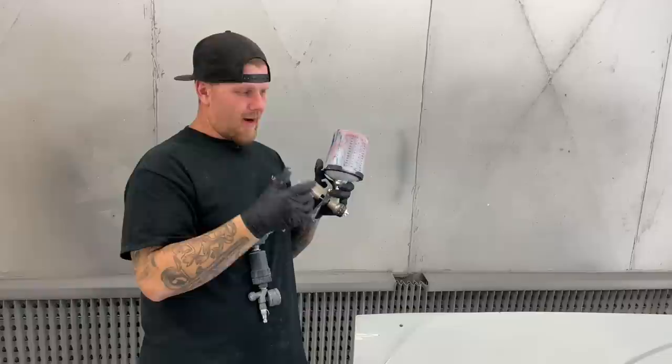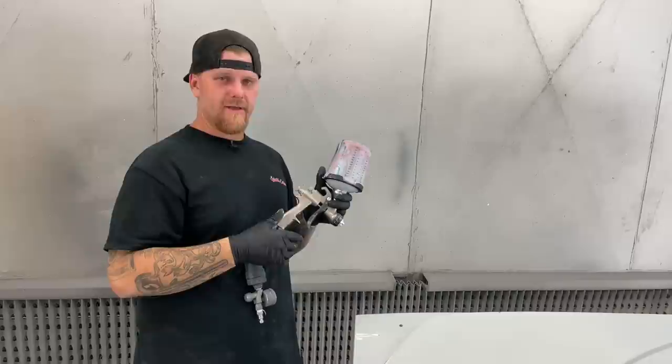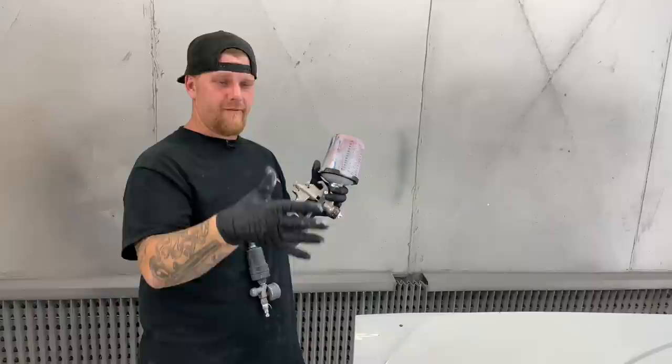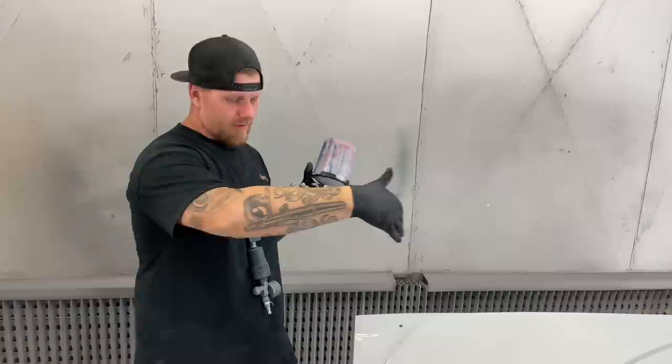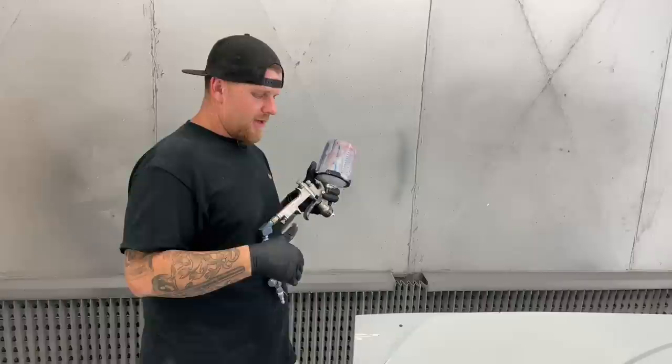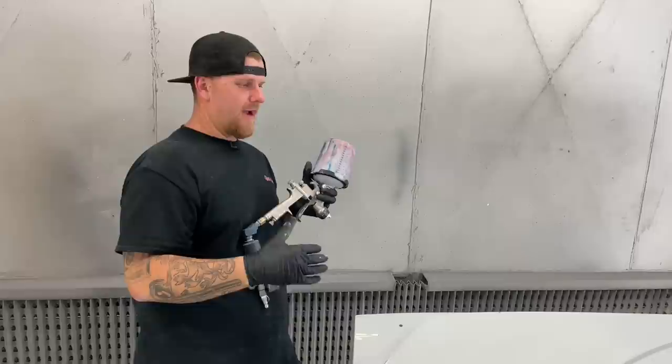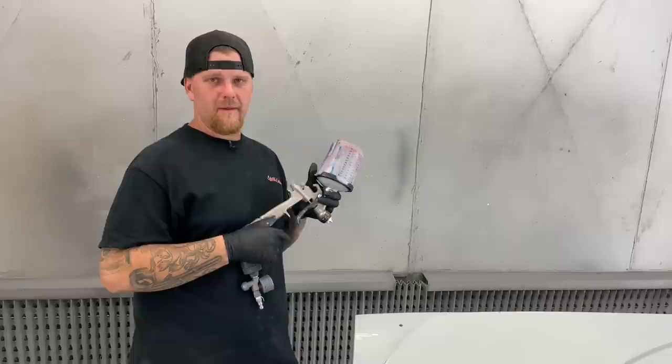Try to think about the details as you paint — aim for one perfect droplet of paint or primer that's nice and even across the whole panel. Otherwise you're going to get a run, orange peel, or it's too dry and not adhering. You want it to just wet out after the second overlap of a 50% coat, meaning when you do one pass, you overlap down 50% and walk the whole panel. We're going to spot prime the filler that's showing and go just beyond our 220 scratches so the whole front is sealed and we don't have to worry about excessive sand scratches from the 220.